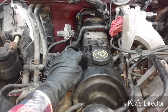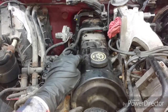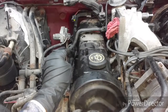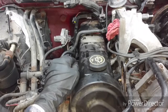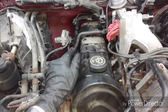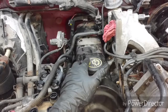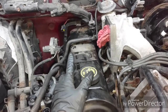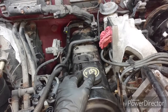I'm going to change the valve cover gasket and throw on the nice blue Fel-Pro one, torqued to spec. The sad thing is when I took them all off they were all loose — none of them were tight except one. Of the eight 8-mil bolts, only one was actually snug, which explains why they were leaking. After the gasket is on I'm going to put the valve cover back on after getting it all painted and cleaned up because I don't like rust.